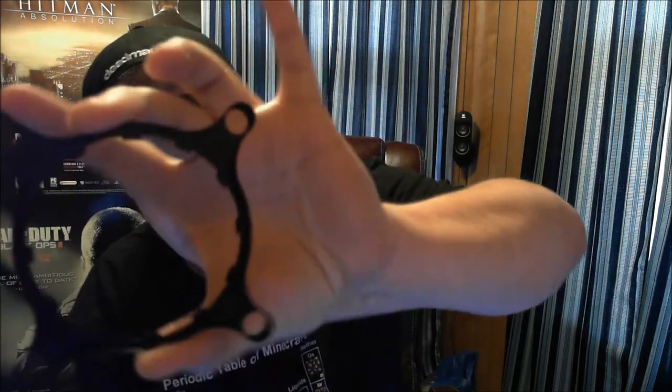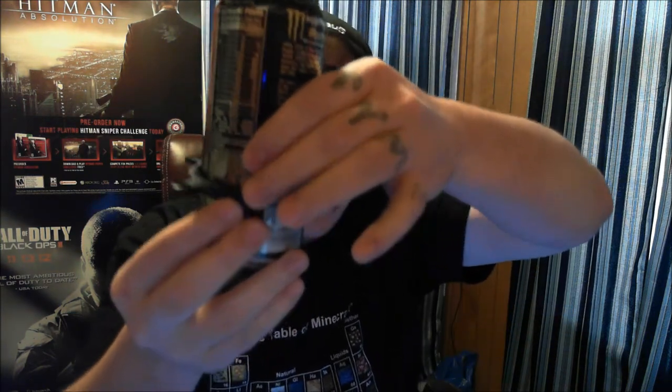Here's a new piece — a retention ring — and it's supposed to aid in the installation. I didn't do it, but I've seen other people make videos of it and it seemed a lot easier. Here's the actual block, the part that holds down the block. With the screws on it, you drop the CPU in, twist, bring it up until it clicks into the tangs — the grips, the grabbers — and then you run your ring on the bottom. It snaps in place. Your CPU block is locked into this whole thing as one unit. So when you're ready to install, you drop it right down and tighten each screw instead of all the fumbling I had to deal with.